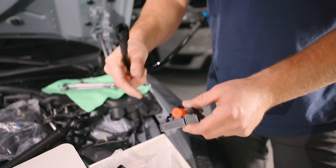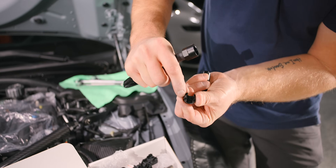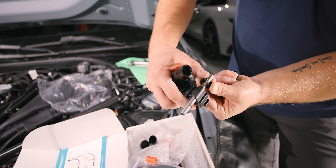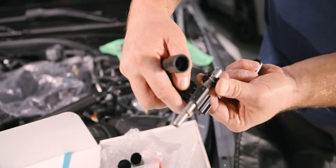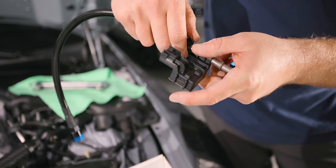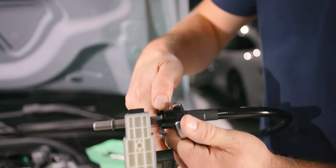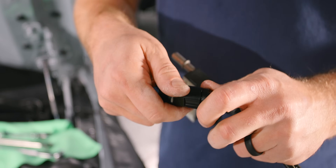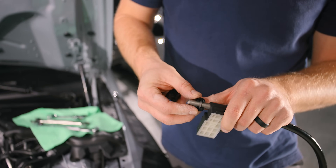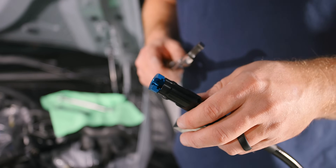To prep this, first take off these ends and loosely unscrew this piece. When you look at it, there's a little tiny groove cut in there. The edge of this is going to sit right in that little groove — you can see it slides right in. Then you put it in here and snug it up. For this side, it's a 16 and a 19. Then install the adapter the same way — look for the groove, slide it on, push it on, and snug this one up. This one is a 16 and an 18.